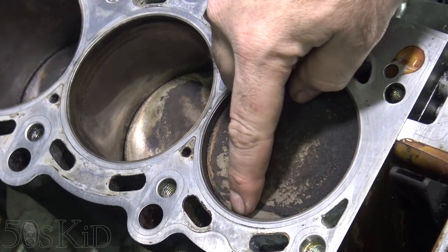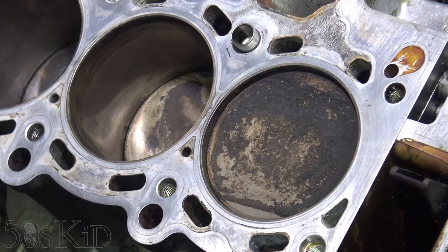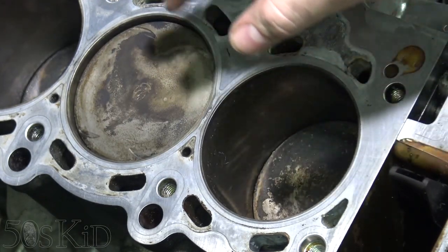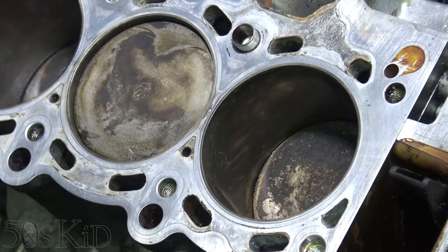This is piston number one right here, and you can see this area where there's no carbon — that's where some of the coolant was sitting. I just left it sit there overnight because I didn't have paper towels when I called it quits. When I came back and wiped it, yeah, it got that carbon off. So just coolant will definitely eat into that carbon and get it off. Let me show you cylinder two — it has very little carbon on it, nowhere near as much as number one. It has the least amount of carbon of all the pistons, and I think that sort of proves that cylinder two is where that coolant was leaking in, just cleaning off that piston over time.